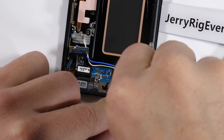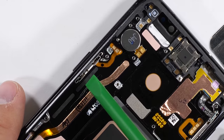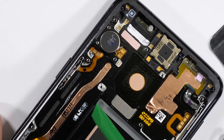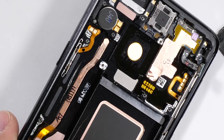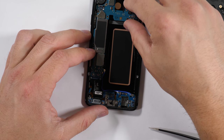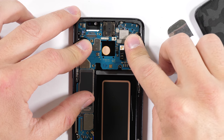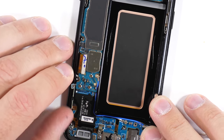The charging port is in place and screwed down. If we look up here on the left, we see Bixby's little home — it's got one button and a little ribbon with some gold contact pads. It looks pretty easy to remove if someone wants to be adventurous; they can just pop the button out, or leave the button in place and rip off the contact pads so it never works again. I'm not suggesting murder, I'm just saying it's possible. The motherboard gets clipped in at the bottom first with the charging port, and then set down into the aluminum frame of the Galaxy S9. I'm leaving the camera unattached right now, but the phone should still work without it. Front facing camera is plugged in, and the screen ribbon is clipped into the motherboard like a little Lego, along with the three little signal wires at the bottom.